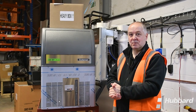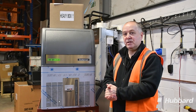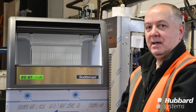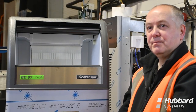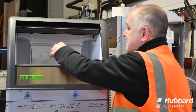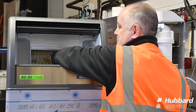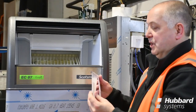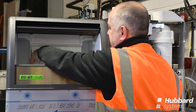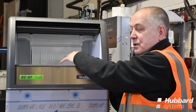When attending a service call on an ice machine reported as not working, it is worth checking some common operator faults which occur when the unit has been placed back together incorrectly before taking panels off. Common operator errors include the spray curtain not being correctly mounted and allowed to wobble, which prevents water from blowing up into the evaporator section, the curtain being inserted the wrong way round leading to a shortage of water, and the sump cap spring not being put back on correctly or being knocked off by an ice scoop when retrieving ice.